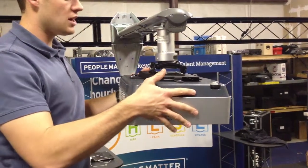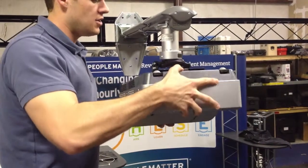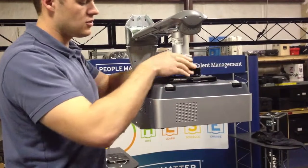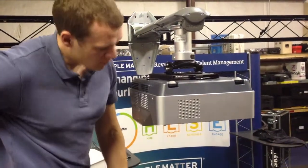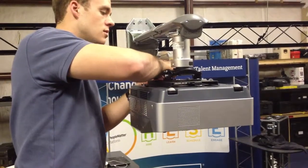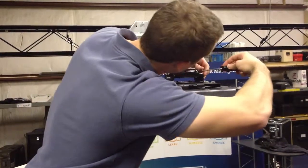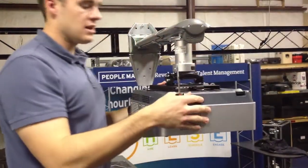Then you've also got your yaw, your roll, and your pitch, which is a little bit stiff but once you've got the other two locked in place, it goes a little bit smoother. All you have to do to lock it into place is you can take a screwdriver from right where you're standing, lock your pitch, lock your roll, lock the yaw, and you've got the projector exactly where you want.